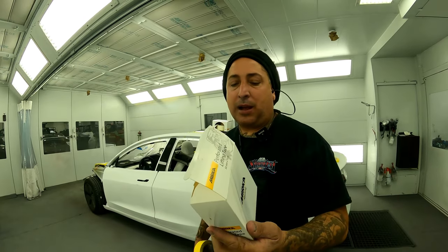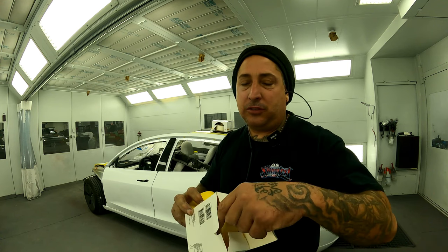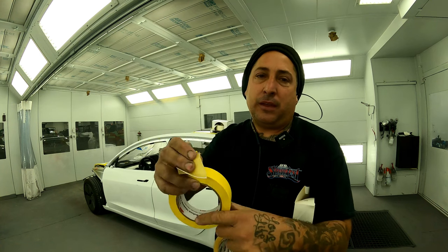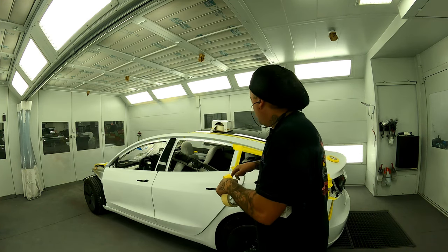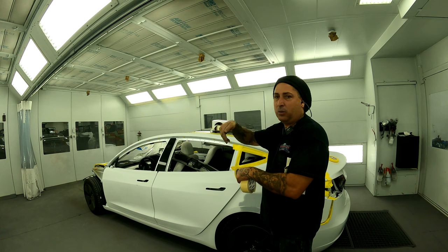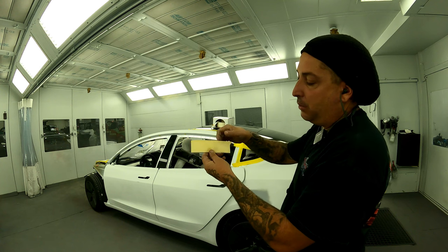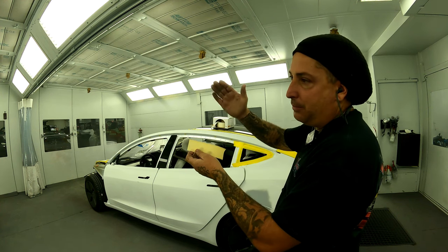The next product we'll try out is this perforated lifting tape, and it's a lot like the other ones they make out there. I like this one because it's cut individually for you — some of them you have to use scissors or blades, but this one actually pulls off in little pieces so you don't need a blade or knife. We're going to use this up on the top of this glass pane to pull that rubber back and get it nice around that corner. I usually don't go any bigger than a six-inch span with lifting tape; it works better in small sections with overlap, because a long piece tends to pull out from the top or bottom.